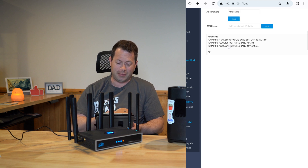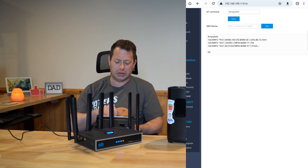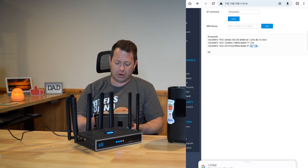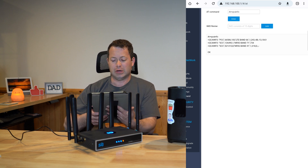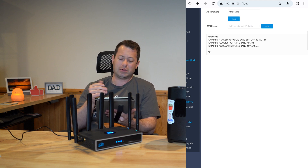I'll do an example on the 5G, but it's the same process for 4G. You need to grab the ARFCN number, and you also need the PCI number — the Physical Cell Identifier — which is basically the cell tower identifier. In my case it's 318 for N41. Above that, N71 shows 734, and the one above that is 243. It's typically the second number after where it lists the band number.